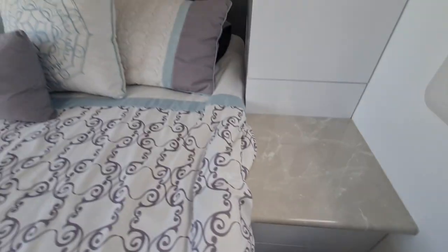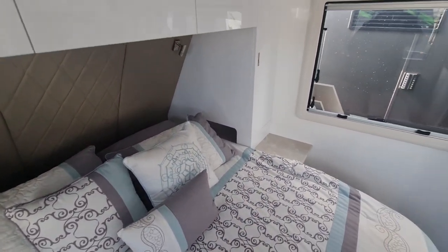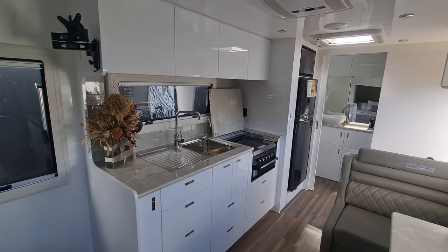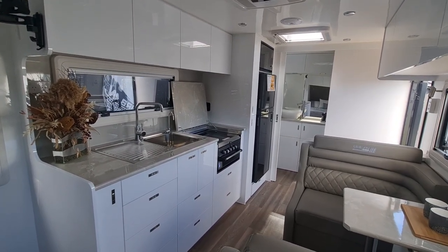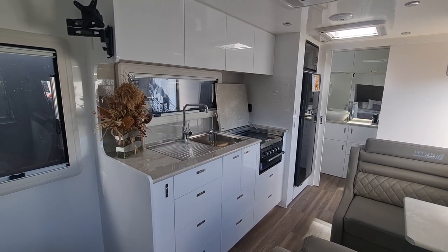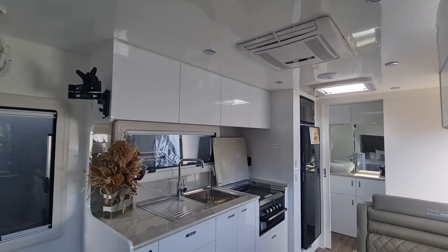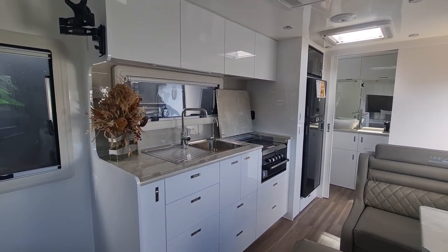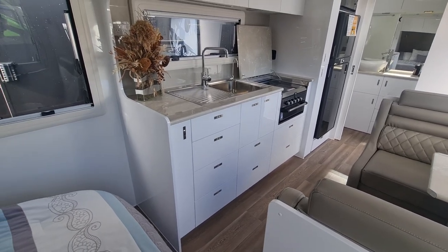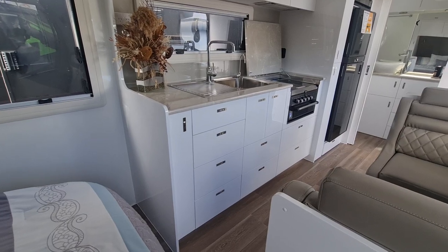This is the same layout Sarah and Keelan have in their van. The 18 foot 9 is a very popular model — people like the shorter length because it saves weight. Being a full off-roader at 2600 kg, that's pretty impressive. On the inside you've got a TIG-welded RHS frame, inner fibreglass walls, and a honeycomb floor almost an inch thick — so very well insulated and one-piece all the way from the back, so no creases in the liner.